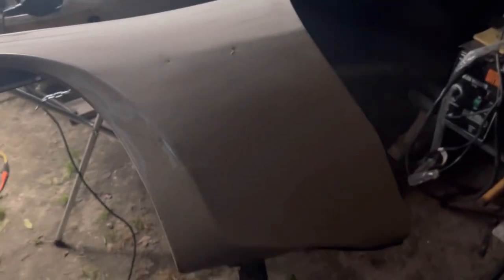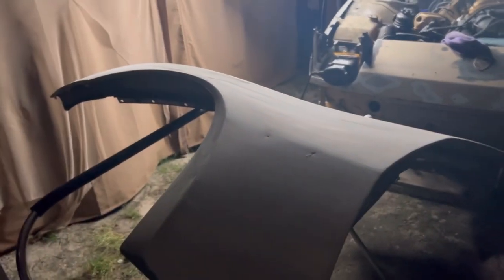Right now I'm setting this bumper down. I already had the other bumper on the driver's side sanded, but we are doing the passenger side now and it's turning out really well — I'm actually learning a lot. I also need to get some lights for better lighting, but I do have my halo light which has great lighting. For sanding, I started with 80 grit, then 120, and finished with 320. Both bumpers are done at 120, just got to finish with 320.